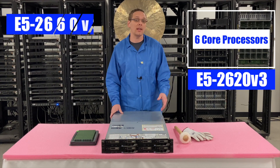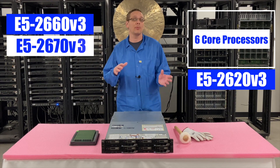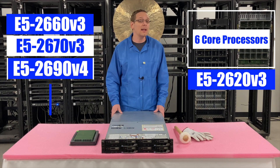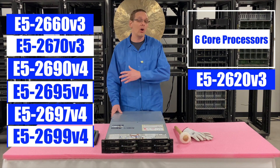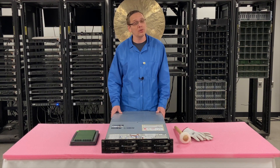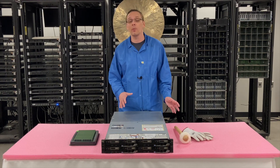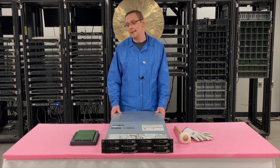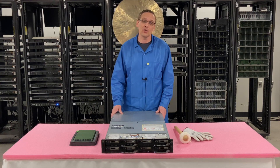The value ones I like are the E5 2660 V3 and E5 2670 V3. If you want something a little more high end, you can go to the V4s and get something like an E5 2690 V4, E5 2695, 2697, or 2699 V4 — all really great high-end procs, but will cost more. A lot of people are using those right now since there is currently a server shortage and it's hard to get Intel scalable procs. Going with some high-end V4s is a good solution if you don't have lead time, since some manufacturers are three to six months out for brand new servers.